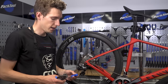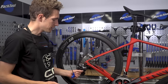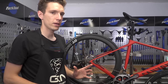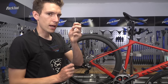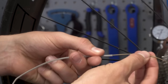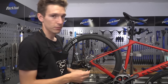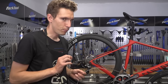The first step is to remove your old cables. To do that, we need to loosen the Allen key cinch bolt on the derailleur — it's the same for either the front or the rear derailleur — and then snip off the cable end cap using your cable cutters. Before we pull our old cable out, we need to do one quick check: to see whether our cables are routed internally, like this one where they're hidden inside the frame. If they are, we need to use a thin plastic tube. Thread it over the old cable and into the frame, so that when you pull the old cable out, the plastic tube gets dragged all the way through the frame and can then act as a guide for the new cable. You literally put the new cable into the tube and reverse the process — it can save you hours of poking around inside your frame.